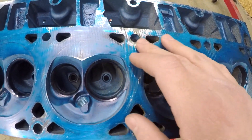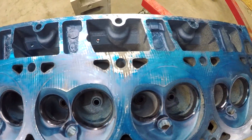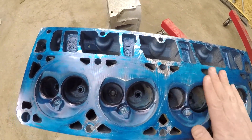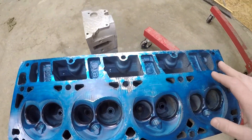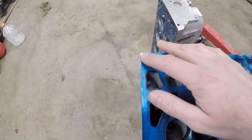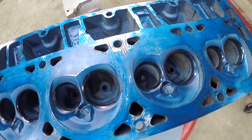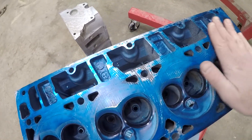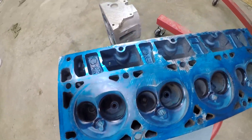Really this head is gonna sit on three points — any part that you want flat is gonna sit on three points one way or another. It's gonna sit on the highest points until you really torque it down and make those points even. Going to the other edge, this is where the other high point is — you can see where the mill marks are higher than the whole entire surface. This head didn't do a very good job of showing that it's super flat. I don't have a good majority of the blue dye wearing off, which is kind of concerning.